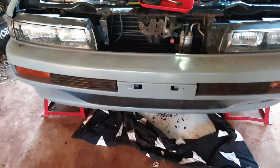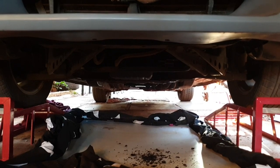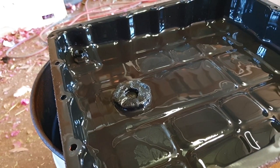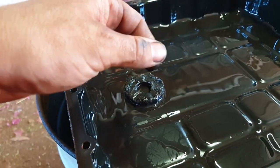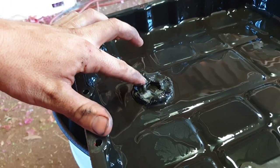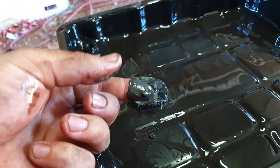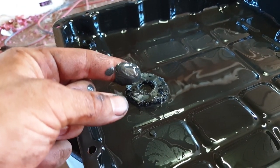The reason we're on ramps is underneath here — I've had to drop the oil pan for the transmission and it was full of gunk. I've just finished pulling the pan off the automatic transmission, and even though I thought I had flushed this out, that is still a lot of gunk. Look at this magnet — it is just coated, thick with sludge. This has never been changed or replaced at all. It's absolutely disgusting. So anyway, we'll put the new filter kit in and hopefully we might actually get some decent acceleration now.